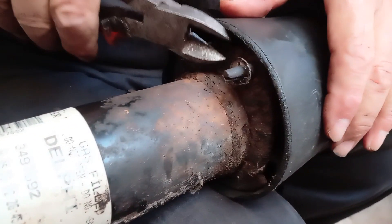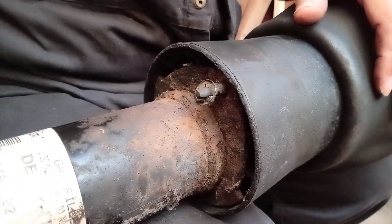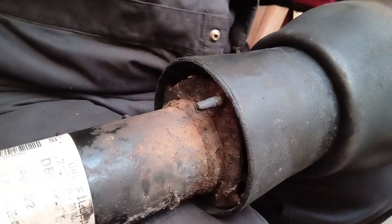Put an alignment pin on the bottom of the air spring assembly and safely remove it using any tool of your choice, as you will also be replacing the pin. I used a cutter plier.